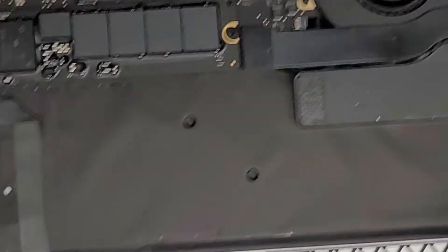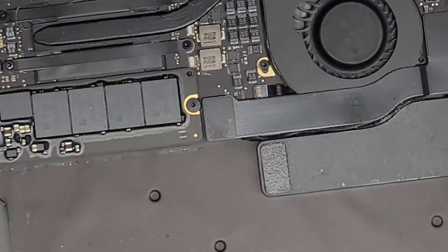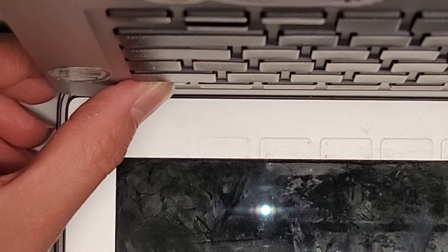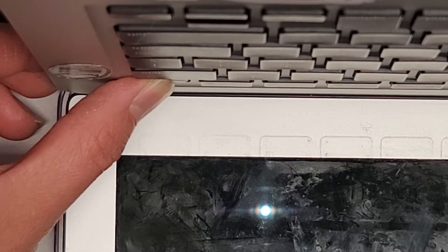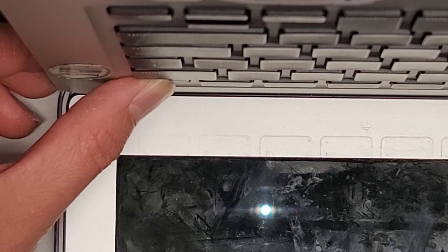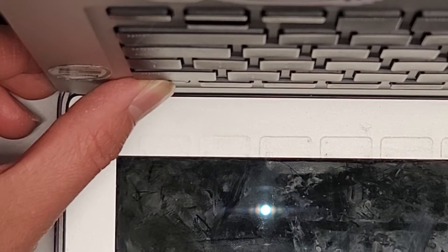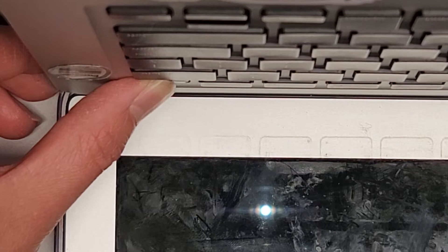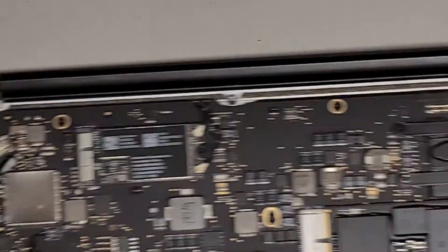Let's go ahead now and check the USB port. Just to be safe after removing the battery, we're going to press and hold the power button here for about 15 seconds. This will drain any residual power and make it a little safer to work on. It's not super important for what we're doing, but if you pull out the screen cable you can badly damage the computer, or if you drop something metal on it. It only takes 15 seconds, so might as well eliminate the risk.